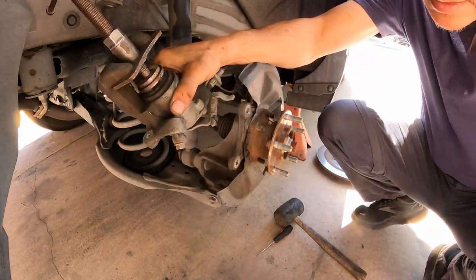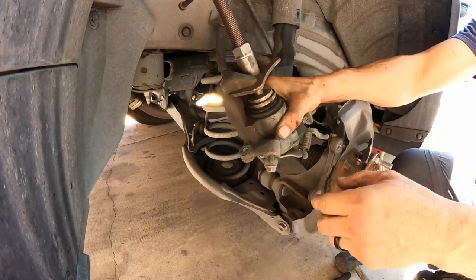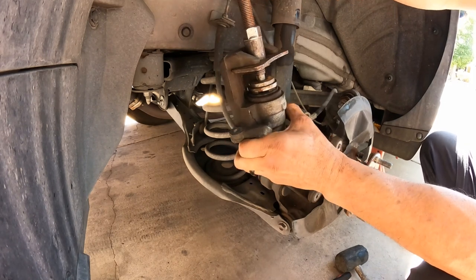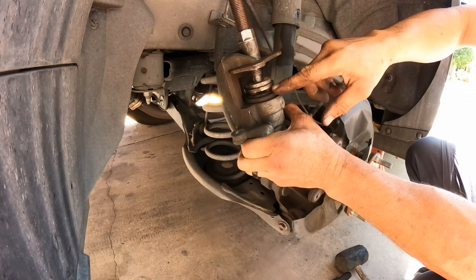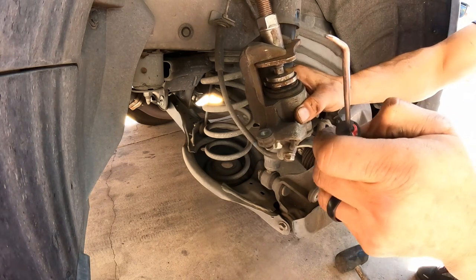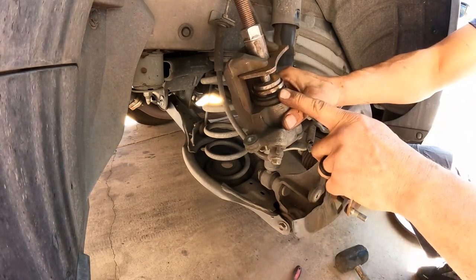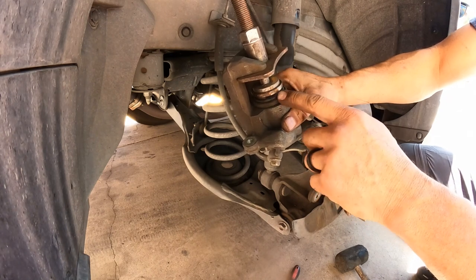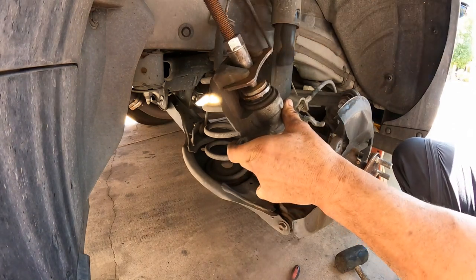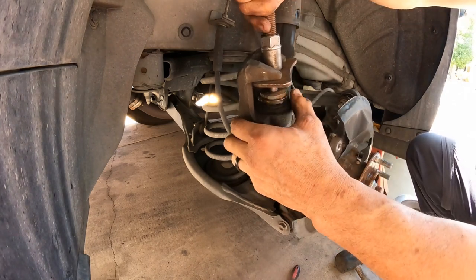You can see how the tool is actually in place. You're going to need a seven-eighths socket at minimum, and this tool is a seven-eighths. You're going to start twisting here. One thing you have to be aware of: sometimes the dust boot can get stuck to the piston and start to twist. If you notice that happening, you have to stop and break it loose by coming in here between the boot and the piston — just like this — and break it loose, otherwise you'll turn the boot and eventually it's going to seize the caliper. Make sure the boot is fine and not twisting. Every time you twist a little bit you have to adjust that little nut right here.